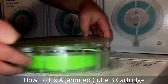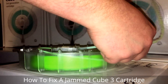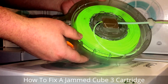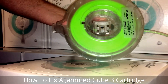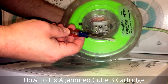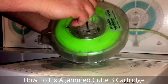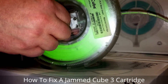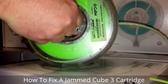Once you've got that freed up, you're going to remove this piece. Basically what we've got going on here is how the printer actually feeds the plastic material into the printer itself. There's a set of cogs or gears in here. What I use is a 1/8 inch regular screwdriver — you can use that to advance the plastic. Turn counterclockwise to advance the plastic.